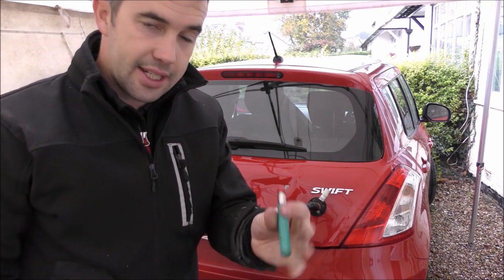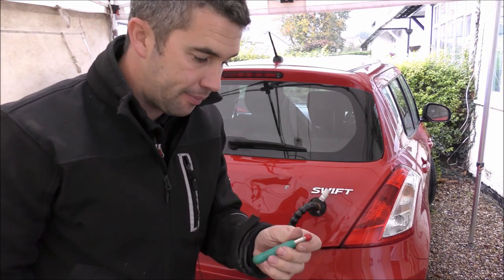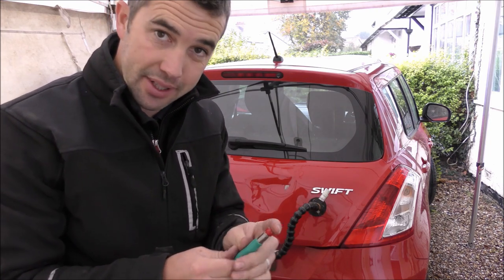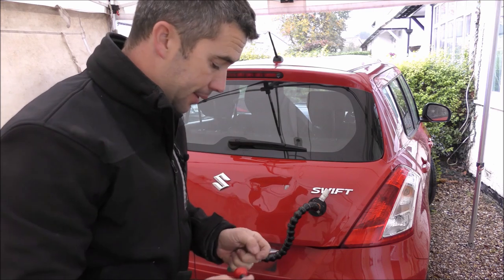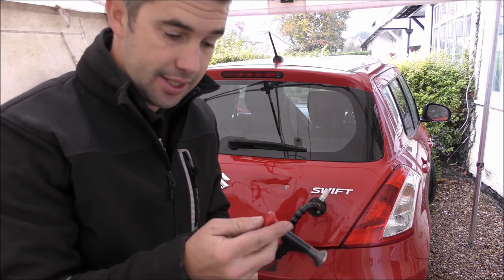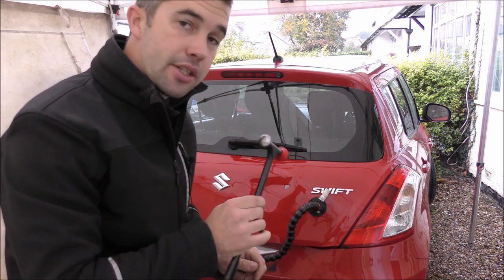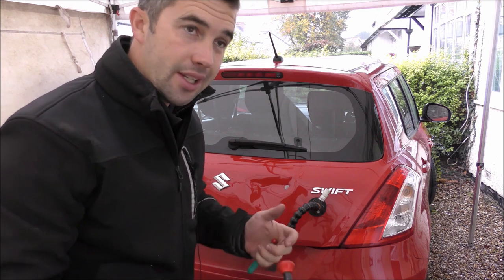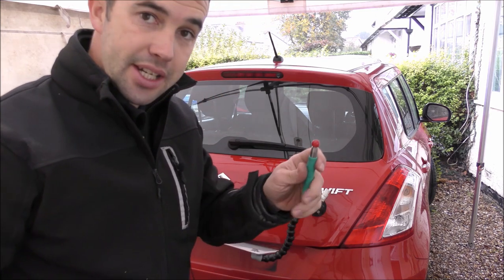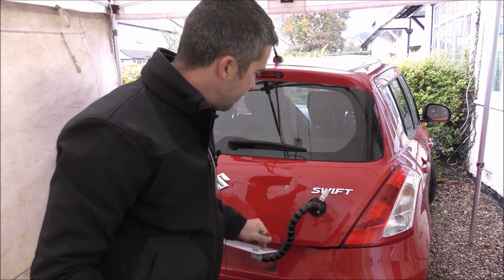So I'm also using this little knockdown. I've had this for years and can't remember where I got it from. But it's just a little metal knockdown, and I've just put a red cap on it, just to soften it up a little bit. And then this Shane Jacks blending hammer. I've been playing around with the different ends. Put one of these Dentcraft rubber tips on it. Again, just to really softly work some of the highs down without putting divots in it. But yeah, a combination of these to soften the blows. And again, just take out some of the high spots around.